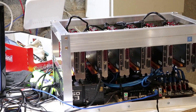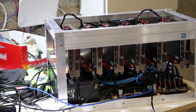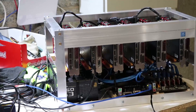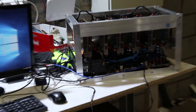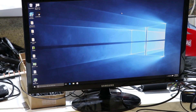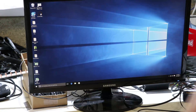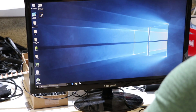As you can see, we are using RX 580s — Power Color RX 480s with Hynix memory, 8GB cards, on a decent mining rig. We are using two 650W power supplies on this 6-card mining rig. Without modifying, these cards run about 24 MH/s on stock. But modifying it is quite tricky on the Hynix memory.